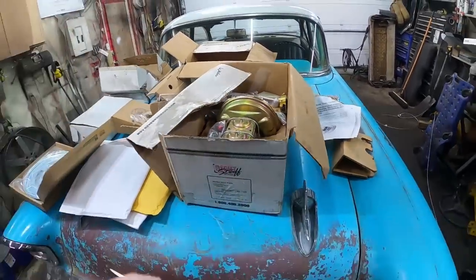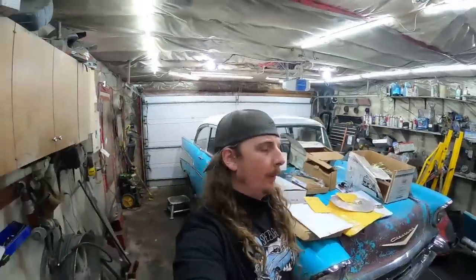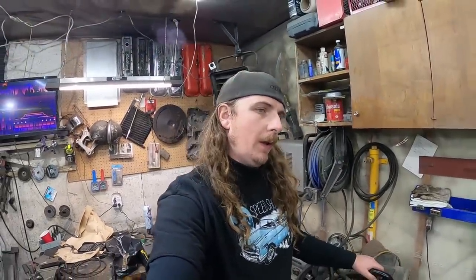Look at this thing jacked up - we'll get under it. Alright, well I got her up on stands. The problem is I ran regular 3/16 brake line in the back and I didn't use that fitting. I looked in my storage bin, I can't quite find it just yet. I don't want to start taking this thing apart if I don't have this little fitting, because I won't be able to connect the line to the rear brakes. Amazon has the fitting but right now it's like a week away. I'm hoping a local parts store will have it tomorrow. I'm gonna call it here tonight - I don't want to get started on anything because I don't want this thing out of commission for too long.